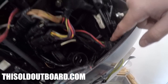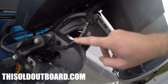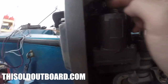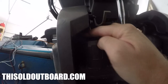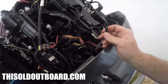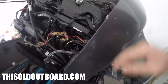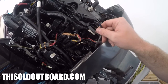You should get plus 12 volts actuating up or down, and then the opposite polarity when you go the other direction with the switch. If you get 12 volts here on this connector, then the problem has to lie between this connector, through the wires, down through this grommet, through here, into the top of your trim motor right there. To recap: if you have 12 volts here, the problem has to lie between this connector, through the wiring, all the way down to your motor. I measured 12 volts here, so I'm going to replace my motor.